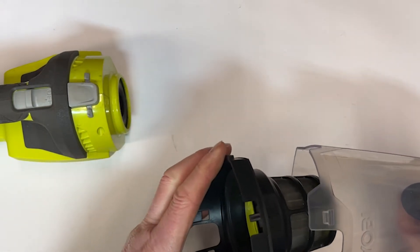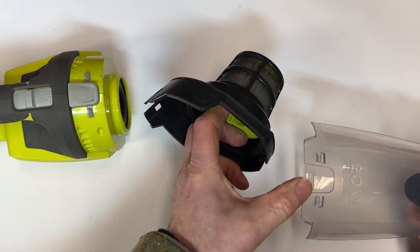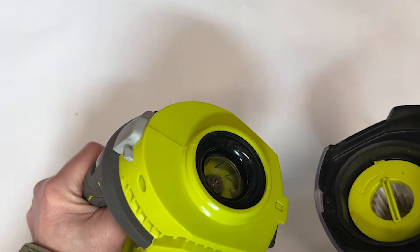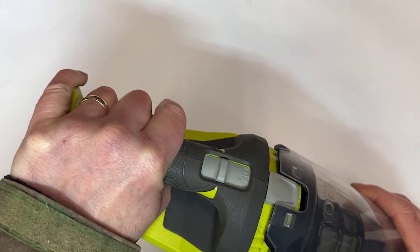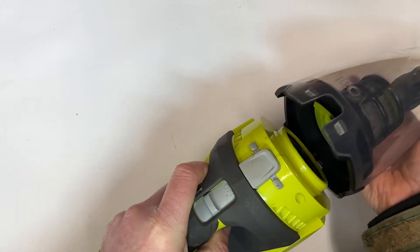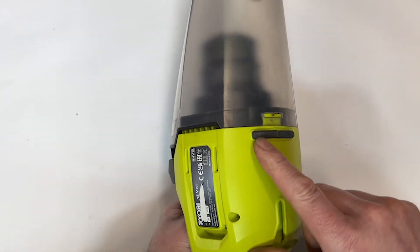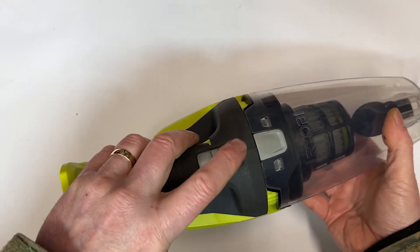Drop this back in — there are lock-in tabs, two of them go under that piece of plastic. It'll be obvious when you've got it in front of you. I find this a little bit tricky putting back together. You've got two tabs that locate with two other tabs, so make sure it's all sat in there. I align the interlock tab first, then lock it home. On occasions I've had it not actually aligned properly and the vacuum didn't work, but once it's clipped in again you're good.